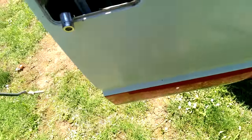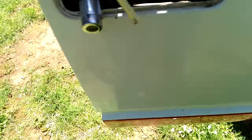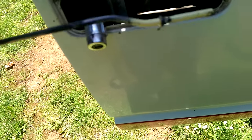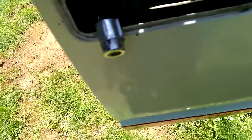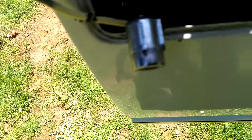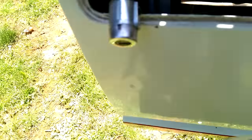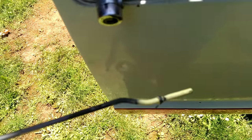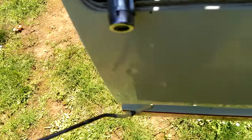This piece here doesn't clip into anything — it just sets down on that little rod, and that's important. That'll get it out far enough so that you can actually manipulate the lock cylinder to get the little metal keeper off the back. If you look down in there, there's a little hole — there's only one hole, so it's pretty obvious where the little rod goes. When you put it all back together, just make sure the rod goes back in the hole as you're setting it back in.